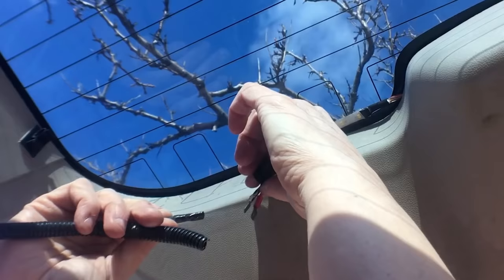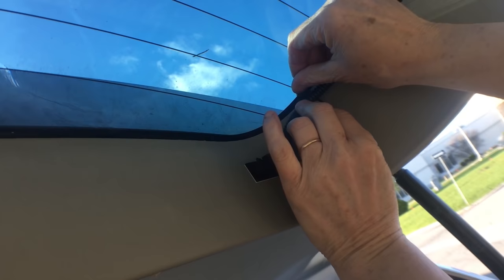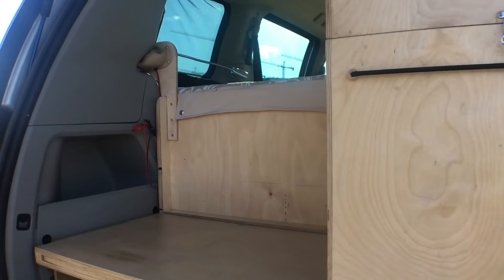These wires are for the lights I installed up in the lift gate, which again connect with spade connectors. These clips keep the wires out of my line of sight when driving — they stick on with 3M tape, but it's hard to get them to stay on a textured plastic. I like to test all the connections as I go along.